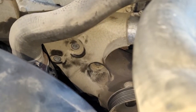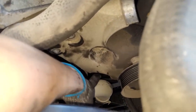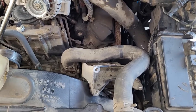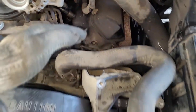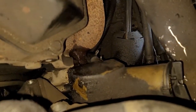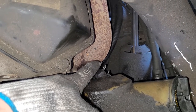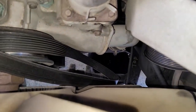Small correction — there are those three bolts but there is an additional one right under here. Once you undo the last bolt, the whole bracket basically just falls off. That is the last hose I was talking about right there, so once you undo that, the whole thing just comes out. Throw a pan down there to collect some of the fluid that's going to fly out.